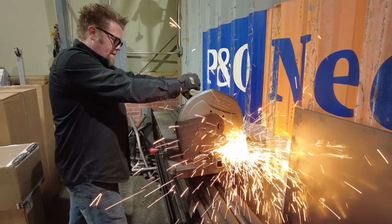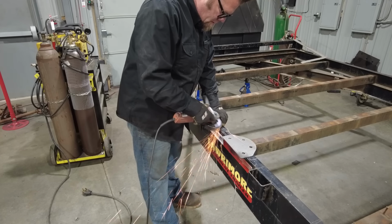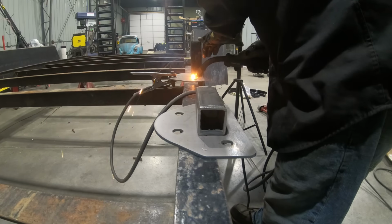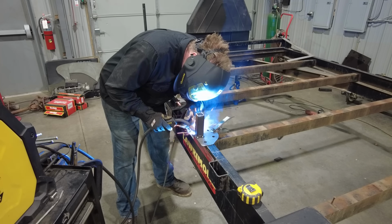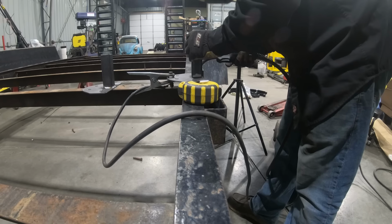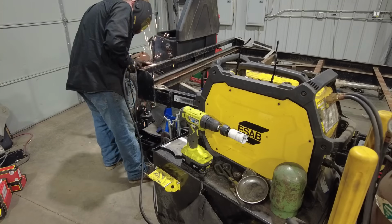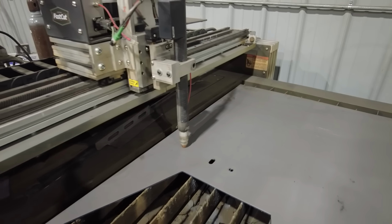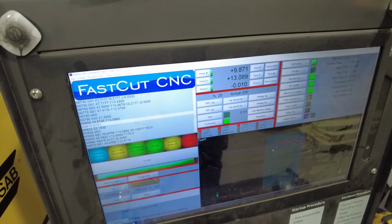The spare tire mount is made from some 1/8" plate and some 1.5" square tubing. A super simple design that's going to be easy to build and effective. The winch mount is also made from 1/8" plate with some integrated gussets and a fairlead mount all built into it.